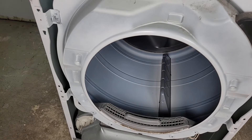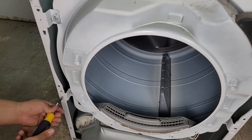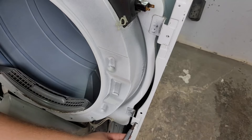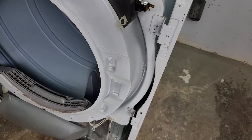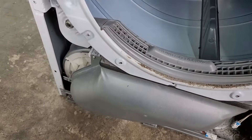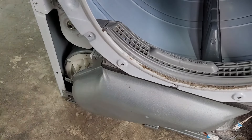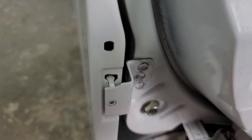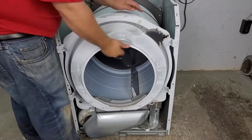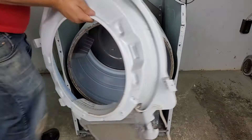Now I'm going to take off all the screws remaining on the front of the dryer: the four screws on the bulkhead, the two between the filter housing and the bulkhead, and the three screws to the blower housing and filter. You're going to need to take off the blower screws and bulkhead screws to remove the front at a minimum. When all the screws are removed, the bulkhead has nice little tabs on the sides of the frame that it rests on — you'll need to lift up on the bulkhead before you remove it, and these tabs make it easy to take off and put back on.